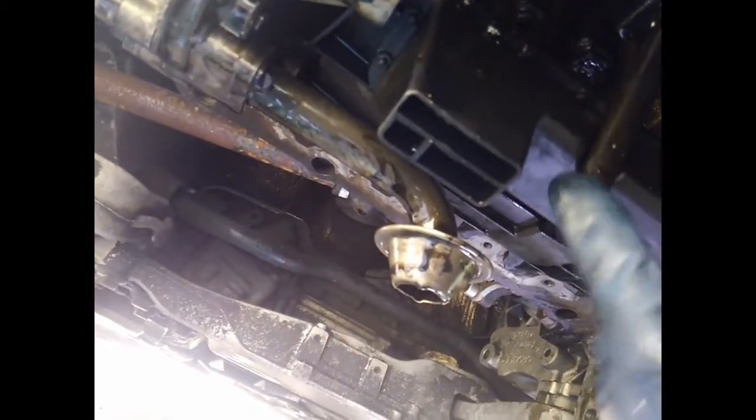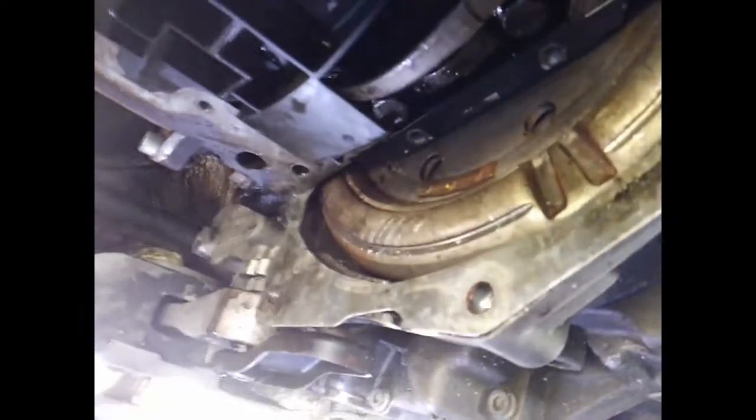Here's that gap — 180 degrees apart — both the springs have a little dip so that you can more easily get at this bolt and rotate it. You can reach in between one of these gaps and slowly walk your flywheel clockwise — you don't want to go counterclockwise or you might mess up your timing belt. For good measure, you should probably check inside your strainer. The windage tray comes out with this one bolt and it slides out from this side past the oil dipstick tube and the strainer. Clean off the gasket surface really good and bolt this back up.